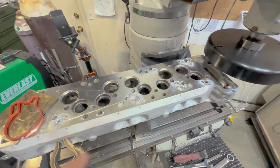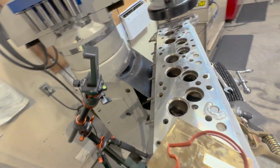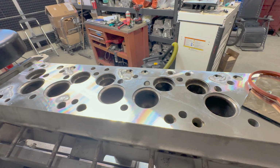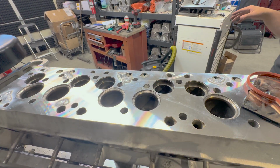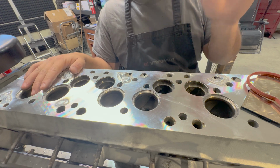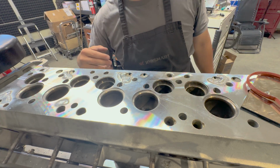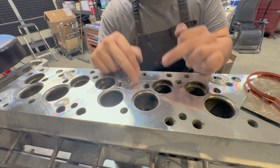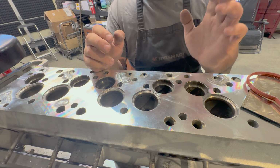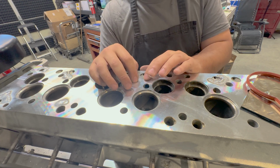It's not a problem, and I'll bet you that it'll surface a hell of a lot cleaner. Now, if you don't know, straight helium on aluminum is cheater mode. If you've got a small machine, you may as well have an extra 100 amps with the helium. It just adds more energy to your arc, and you're going to puddle up on that material immediately.